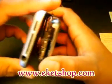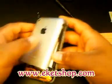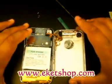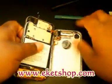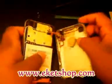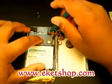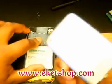Watch out — there's a ribbon cable still holding on to this thing. Do not just rip the whole thing off. You've got to do it carefully or it will damage the inside of your iPhone. Just get your case opener tool and pop off the cable connector. Easy as that — then you've got your back off.